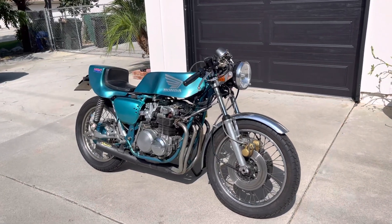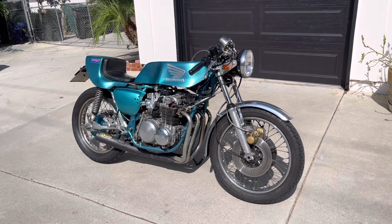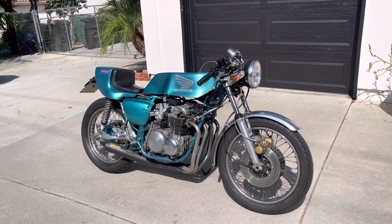Just took it for my first run, just pulled in. I'll get new throttle cables for it because it only has one cable on there, which obviously has an open throttle but no return — though the spring does pull it back. That'll sort the idle out.